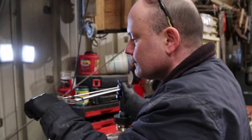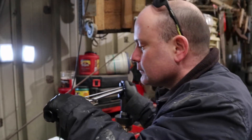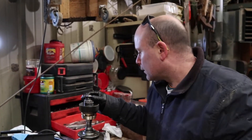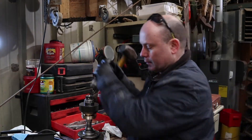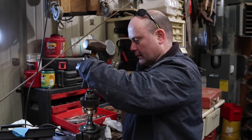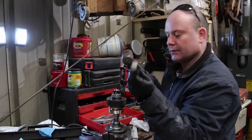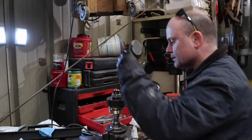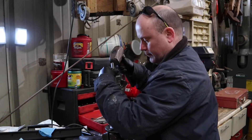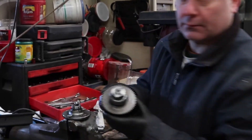Okay, there's 40... 60... almost 80... there. 80 foot-pounds. The next step is to lock this nut on, so I've got a drift here. We'll tap that in. This one is a little sharper than I'd like - let me find a duller one. I'll try one that actually pushes it in rather than cuts. Okay, that looks good. That should lock the nut onto the shaft.